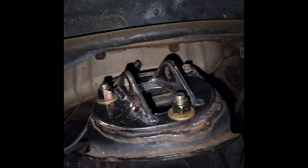I decided to reinforce the steering rack mounts — they are a known weak link on these trucks. I gusseted the center mount before anything happened, but I was too late for the passenger side mount: it cracked on the Rubicon. It got repaired, then gusseted twice, and painted.